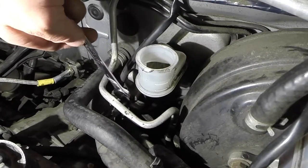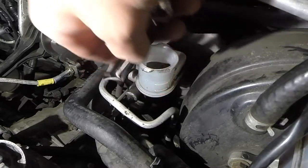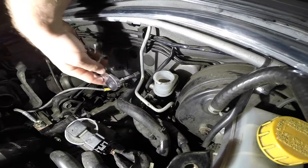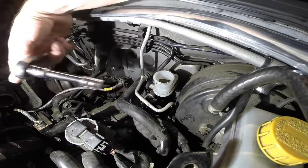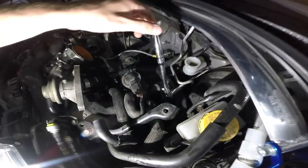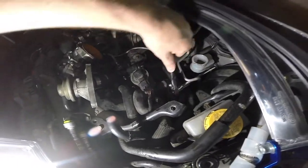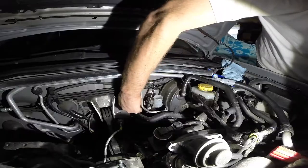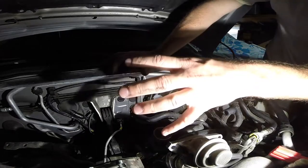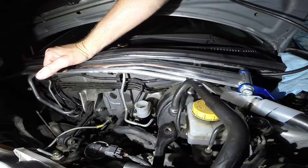There's only one hard line that goes into the master cylinder right here. It's a 10 millimeter wrench and I just broke it free — came apart pretty easy, didn't even spray it with anything. Just keep in mind that it will leak out; there will be some fluid remaining in the reservoir or throughout the whole cylinder, so get some towels ready. Now we're gonna break free these bolts that actually mount the whole cylinder — it's gonna be 12 millimeter. For the second bolt I just had an extender on there, wound it under the hard line and it lines up pretty even. Just gonna unscrew the nuts off the studs — very carefully. And we're done.